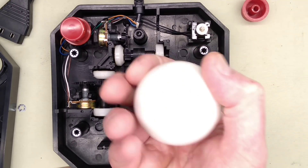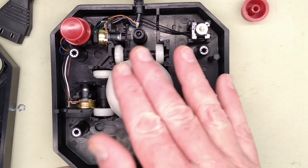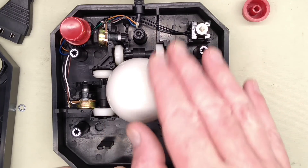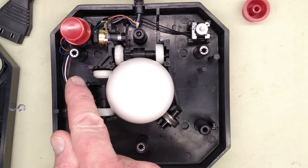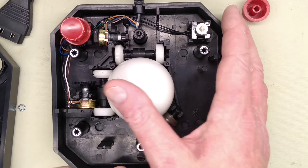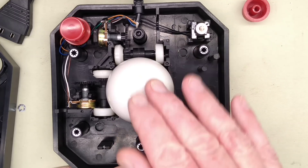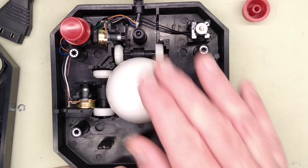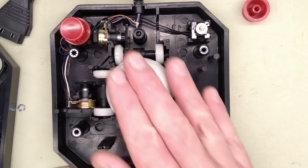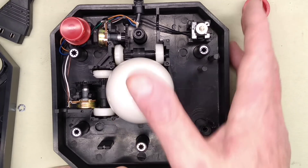The ball feels like a billiard ball — a cue ball. There's an end stop here, though it's actually relying on the end stop inside the potentiometer. These wheels look very rough, like they've been custom made. When the ball reaches the end of travel it just skids on the plastic and on the ball bearing race, so at the extreme end the resistance is quite high and it takes quite a lot of force. That said, you'd only tend to be using it in its mid position, which would be the typical feel for trackballs of that era.